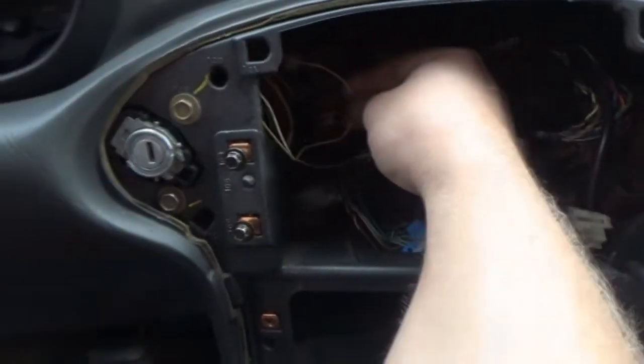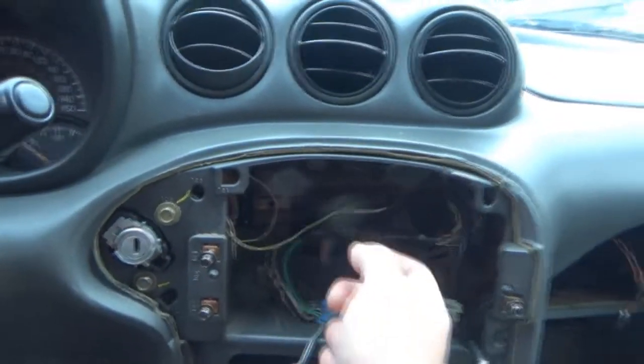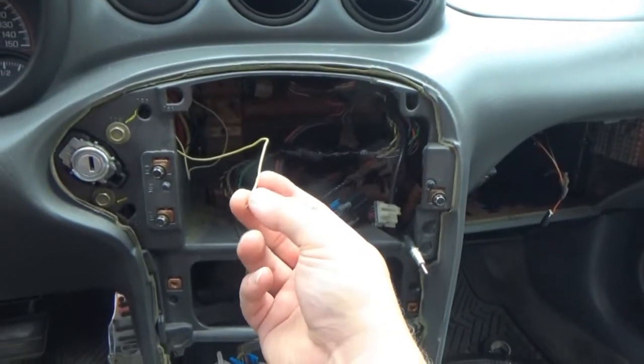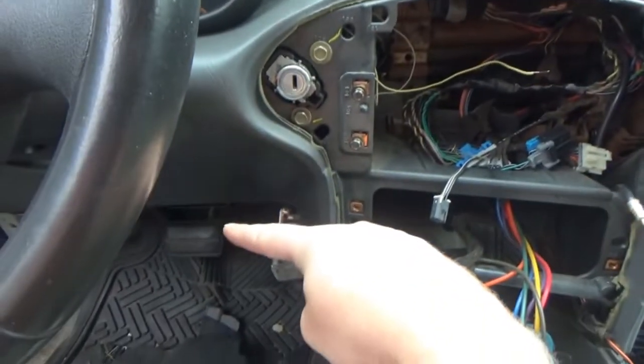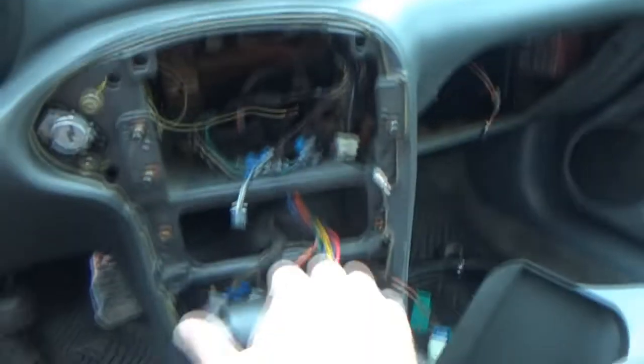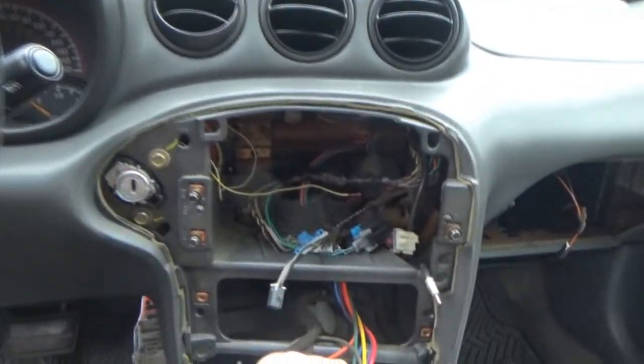And then came the ignition. And they had the passkey, which consisted of this white wire here. There's a black wire and this yellow wire. This is the only wire, like I said, back there at the trunk. They had a thing spliced onto this. It ran to that box. Then another wire came out of the box and went back into the other half of this yellow wire, which is right there. So that appears to be the only wire that was actually cut into and joined by another piece of wire.